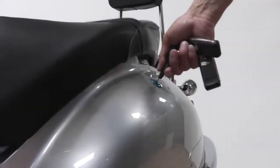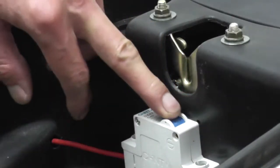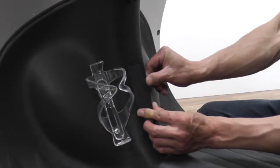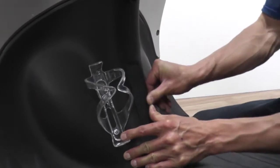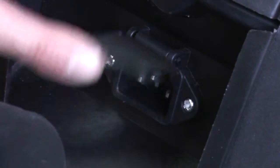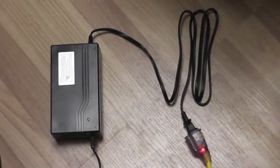Let's now check the battery. Using the key provided, open the seat compartment and lift the bike seat to reveal the breaker switch. Turn on the breaker switch. Take the plastic cover in the seat compartment and place it in the slot located near the bottle holder. To charge the battery, unlock the compartment located in front of the seat to reveal the charger port. Plug the charger to the port and the other end into a 110 volt outlet.